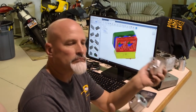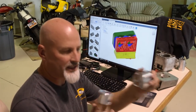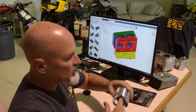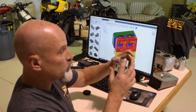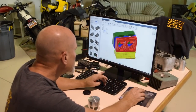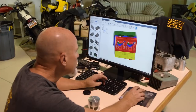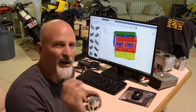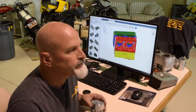One of the issues with this piston, which works really well, but it's difficult to assemble. All of this stuff has to line up perfect — wrist pin bore, intake windows, ring pin, all has to be dead on. If you look at this, the ring goes right down between intake and transfer port. If I'm off even a little teeny bit, I've broken several just by catching the edge of the ring because it wasn't perfect.